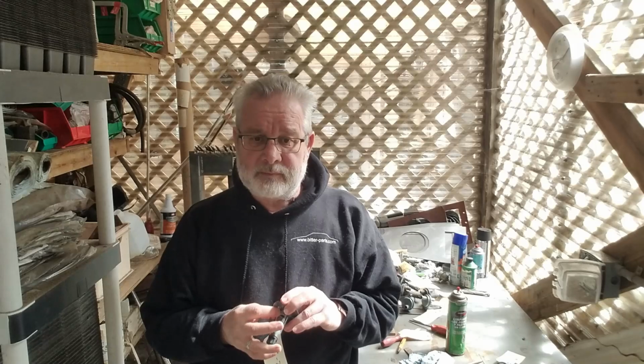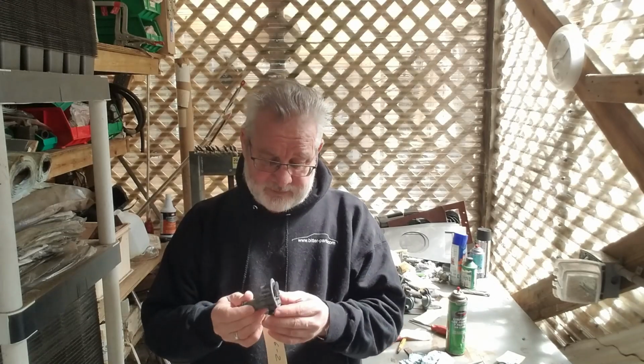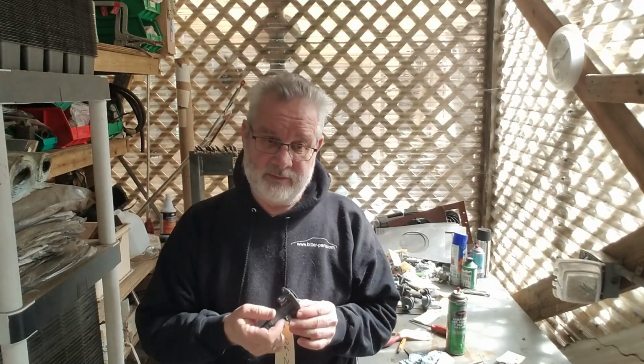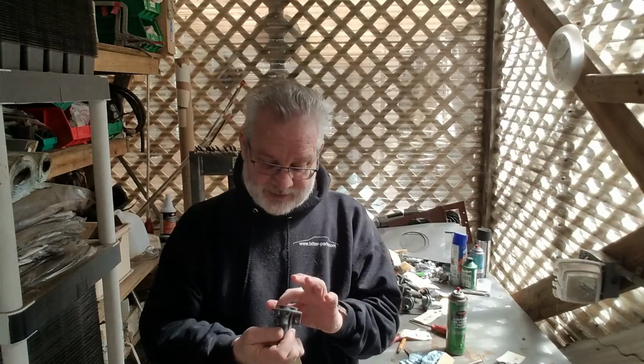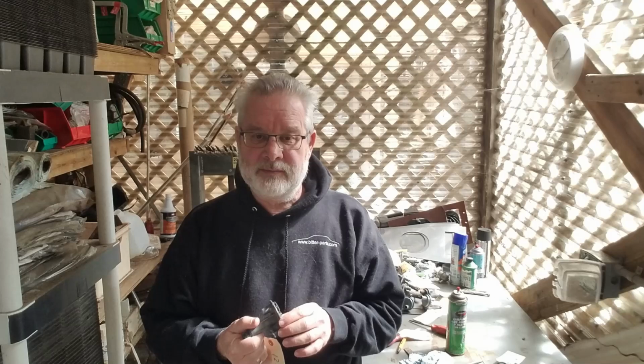And I'm also going to show just the deflection of the bimetallic strip sideways, how it moves. And after that, I'm going to show reassembly and then verify that it works, or if it works, hopefully. But there's no reason, if I get it working, then putting it together should not make any difference. And once that has happened, I'm going to compare that with another time lapse to the new old stock unit, and afterwards test it on the car.